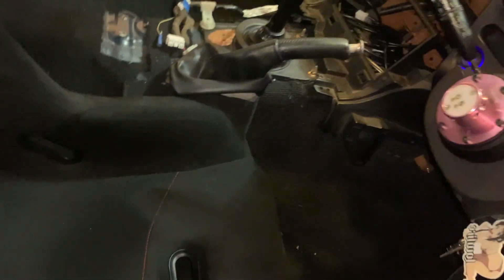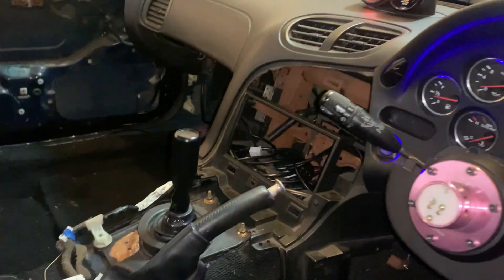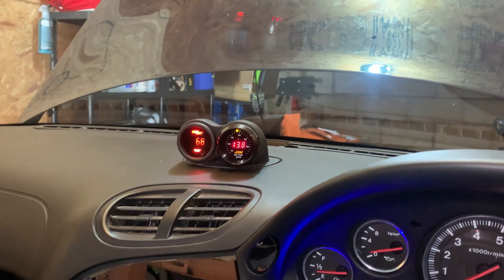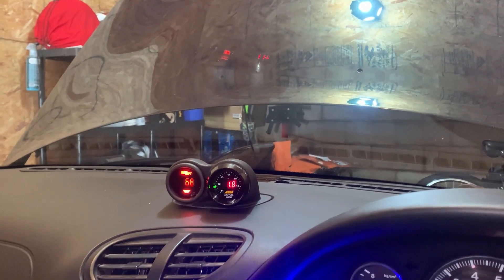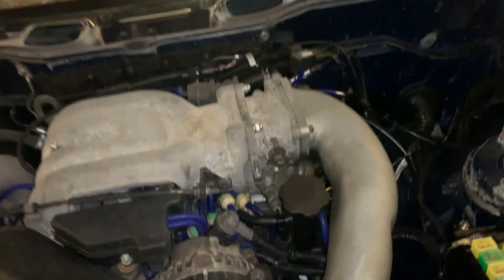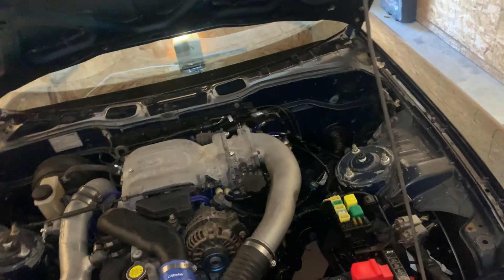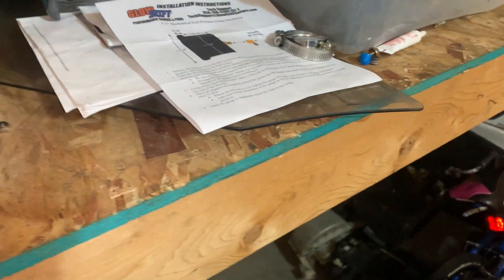Flipping the fuel pump on. As we can see when the O2 sensor reads, it's decent right now, but it will quickly drop to around 10 AFR and stay there even after it's warmed up. The thought is that if this adjustment screw isn't letting enough air in, the car will give the same amount of fuel and run too rich, because it doesn't use the O2 sensors to decide air-fuel ratio when it's this cold — it'll be using the MAP sensor only. Let's find a screwdriver and adjust that.